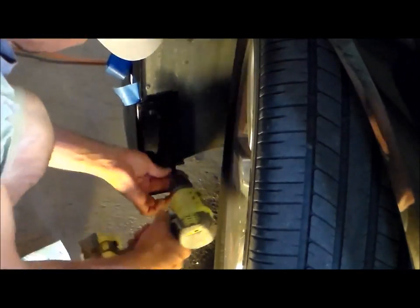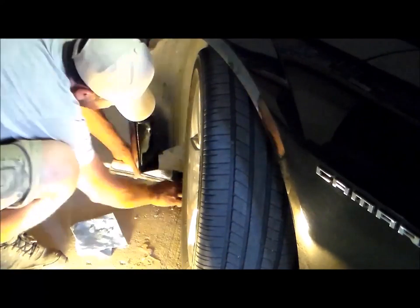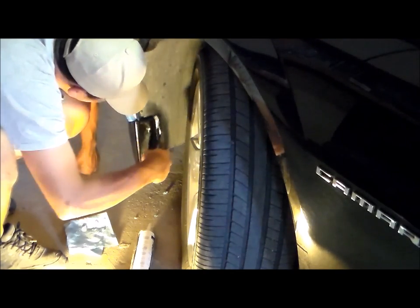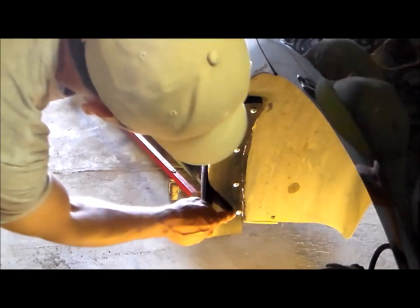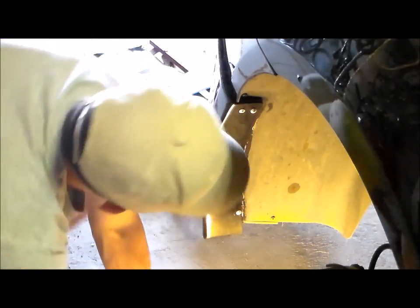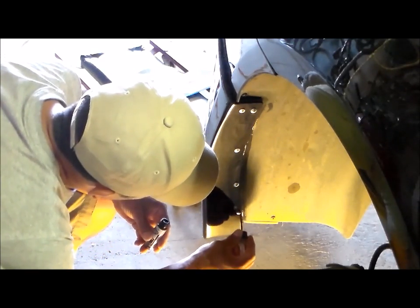Once you've got your screws in place, we're going to apply some rubber sealant inside the gap here — there's a gap that's about a quarter inch and we're going to fill that with rubber sealant. I'm going to apply a thick coat and then use a putty knife to pull it into place. I recommend if you don't have a lot of practice doing this, you should practice before you attempt it — it's not as easy as it looks. Here's a look at the screws on the rear fender well — I added some more screws and then some rubber sealant back there also. Now we're going to go ahead and touch these up with some black paint, or whatever color your car is.